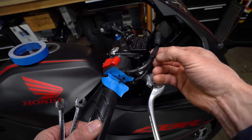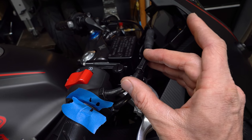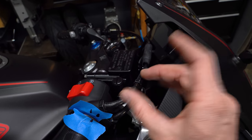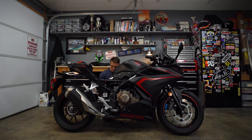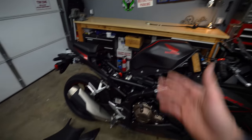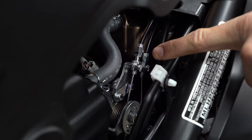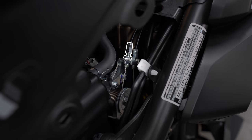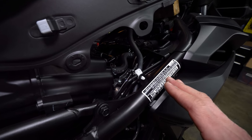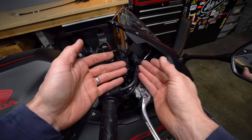Hopefully you can make the adjustment using just the barrel adjuster up here, but if the thread is maxed out and you're unable to get the free play where you need it, the other option is down at the throttle bodies or carburetor. On this bike, it's behind some bodywork — I had to pull the seat off, the side panels off, and prop the tank up with a block of wood. Now you can see the barrel adjusters at the end of the throttle body on the push-pull cable. If you do have to come down here, first go back up and reset the upper adjuster to its closest setting so you've got its full range of adjustment to use later down the road.